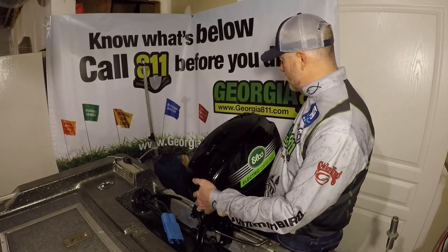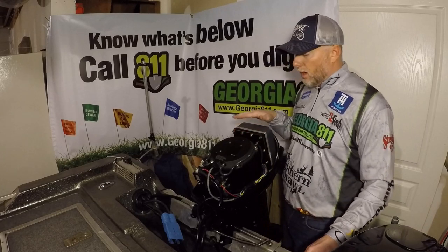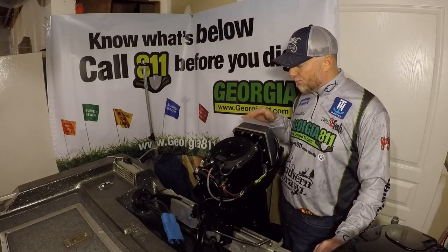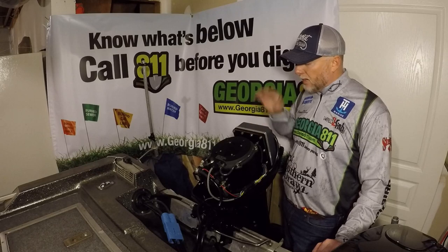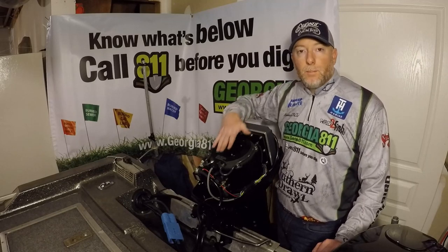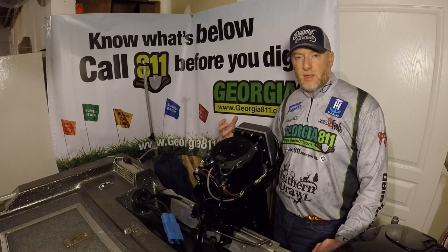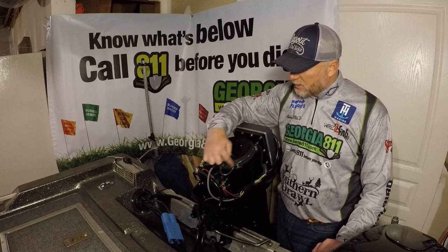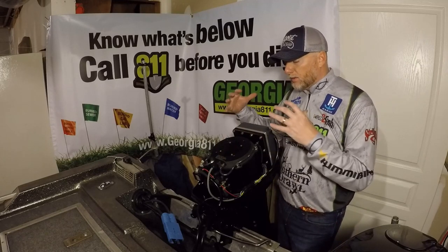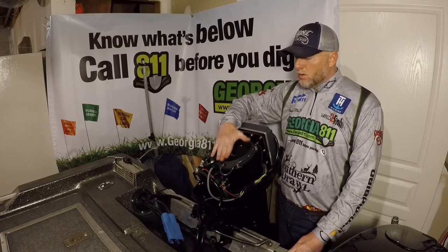Now I'm going to tell you something. It is a really amazing product. Elco offers something that no other electric outboard does. You can go out there and research all the different electric outboards available on the market today. Elco offers a unique, one-of-a-kind system for an impeller liquid-cooled motor. Basically it's the same concept as a gasoline motor, where the water physically comes up through the pump system, up through these hoses into the motor, and physically cools it. With running these electric outboards, with as much power as they make, that heat comes from these motors, and the cooling from the water helps keep them cool.